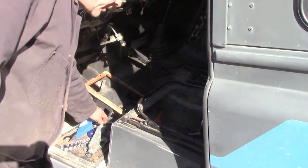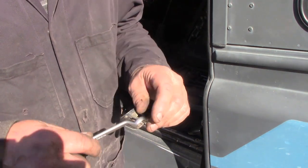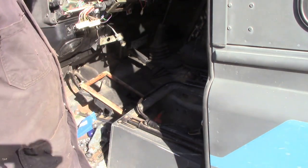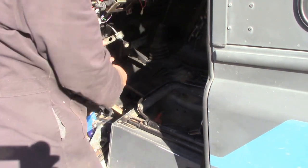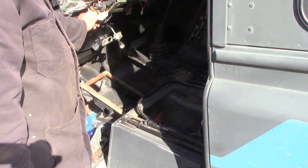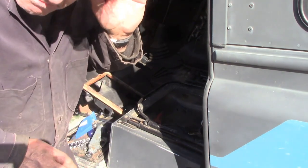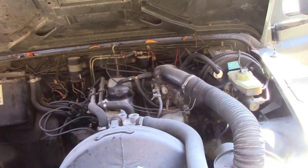I'm not sure if the battery clamp on the ground will work — it's snapped. One thing I wanted to say: the battery terminals on these old Land Rovers are actually quarter-inch width — that's why you can't get a 13mm or half-inch on them. Battery's on. Gear and choke. Well, it turns. I think these had an electric fuel pump. I hear nothing — let's investigate. This car's in remarkably good condition because it hasn't been messed about with.